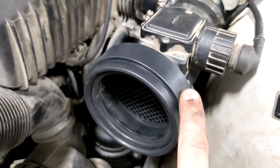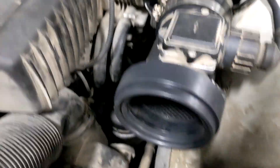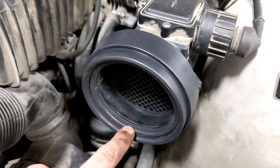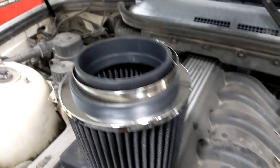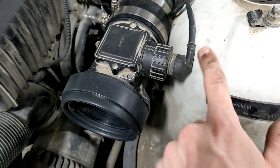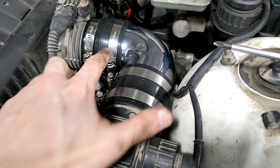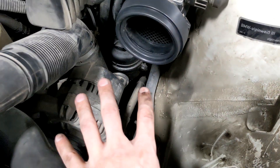The filter has adapter rings, but the filter is so stiff. The mass air flow sensor is a little larger than a standard three inch, so I was barely able to get the inner ring on. Then I had to get the middle ring on, and now I have to get the outer ring on without forgetting the hose clamp. Then I'm going to tilt everything downward as much as I can without the wire harness, maybe turn it a little — I left this loose so I can turn it down and get everything to fit in nice.